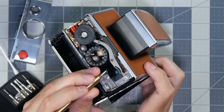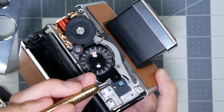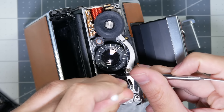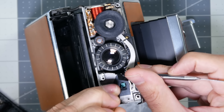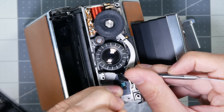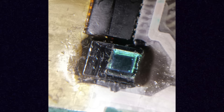To see the light sensor, we have to carefully move this black piece out of the way. This is part of the shutter blade mechanism, so just be really careful. There's actually a lot of corrosion here, so I'm going to use some alcohol on it first and carefully wipe away at it to clean off as much as I can. The problem I've encountered is that there is more corrosion under this piece that I can't get to myself. This piece should look more like a clean window that lets as much light in so it can hit the sensor properly beneath it.